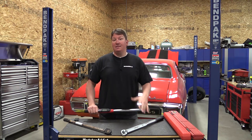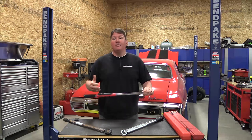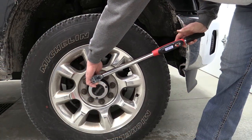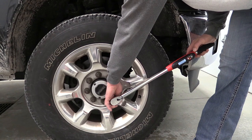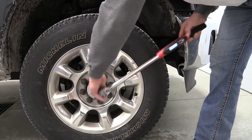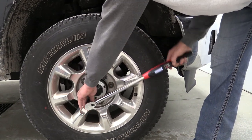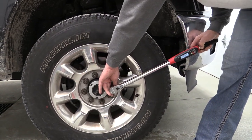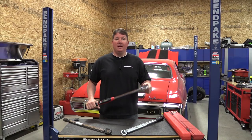The difference between the click type and digital is pretty much the same, except the digital has more features — which means more dollars. On the GearWrench in front of us, you can set it from 25 to 250 foot-pounds. As you approach the specified torque, a yellow light turns on, and within five pounds of it a beep alerts you. For tires, it's an incredible pain because you can't always look down and see it, so you won't be as accurate or as fast as with a click type.